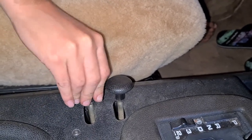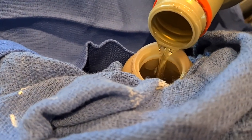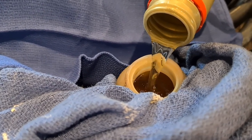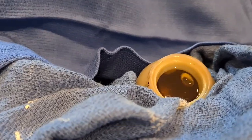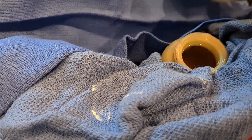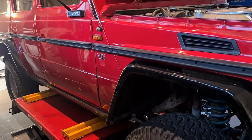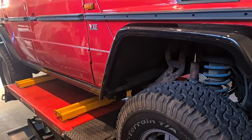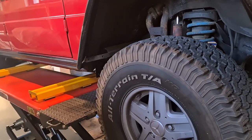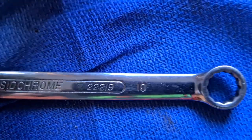I topped up the brake fluid. Again I'm not showing that I had to undo it all again at this point to take that bit off — putting those brake lines back on is not pleasant. Just the air in the system starting to come out a little bit. I don't have a suction device so I'm going to manually bleed this. Without a hoist you would not be walking well for a few days. Using a 10mm to bleed the valves here, I'm at the rear — there's the bleeder valve. Cap comes off, free it up with the lever down.